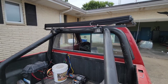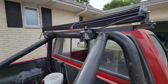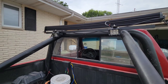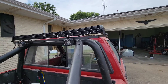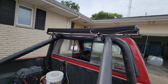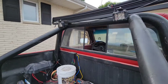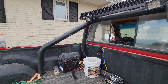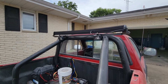I got both the rear pods on. It wasn't really easy — you can see my initial hole is actually drilled right here to get a hole in there and get a wrench in and do all that fun stuff. So I just built some tabs off to come out, and they're pretty secure. Now I get to make my own wiring — I'm essentially just going to daisy chain these two together, try to run this one over there, connect it, negative, do the same. I could most likely run the negative straight to the bar, but I just don't like doing that, because then I can run into potential grounding issues in the future. There's nothing running to my factory battery, but I still might run it down here just to use less of my actual wire. I'll have to tidy up all of that — it's going to look like a jumbled up mess — but I'll probably do that in my free time and not in this video.